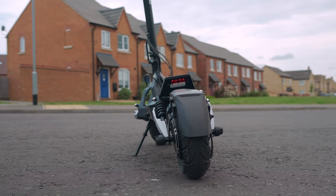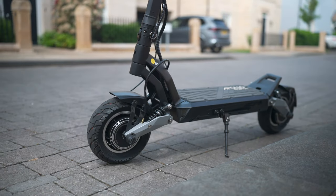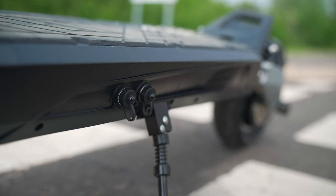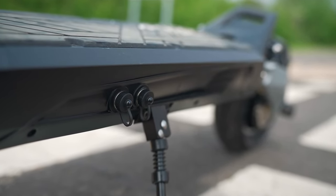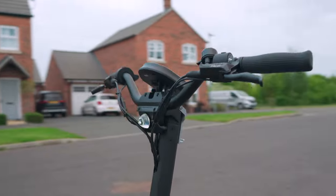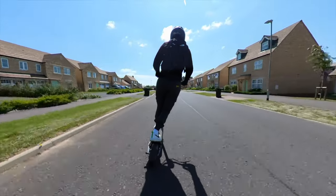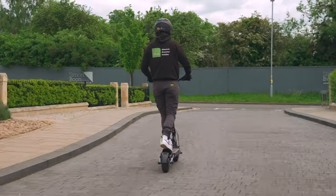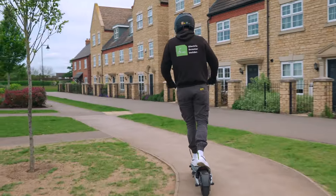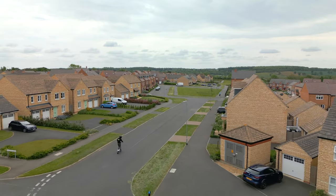The proof is in the pudding though. Even small details have undergone improvements. The steel kickstand not only acts as a sturdy foot for the scooter to rest on, but it protects the charge ports in the event of a crash. The newly equipped screw-on charge port covers are more secure. The electrical components that make up the cockpit have plug-and-play cable connectors, making replacement easy. The smart power management system protects against short circuiting, overcurrent, overcharging, undervoltage, and regulates the temperature of the scooter's core components. And the IP54 water resistance rating ensures that it's protected against water and rain.